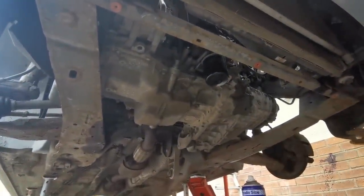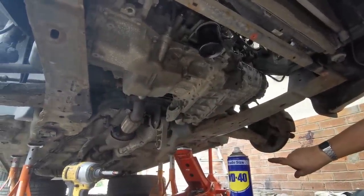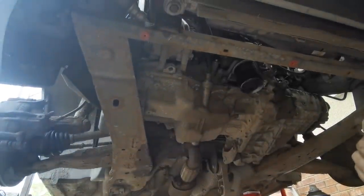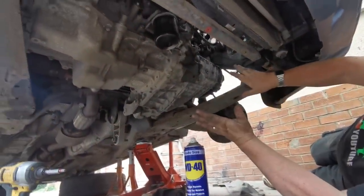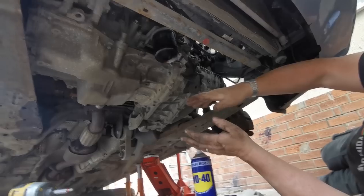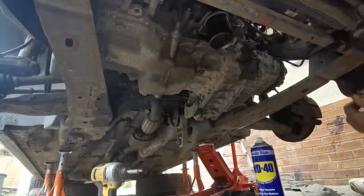We've got the two drive shafts to take out, and then we can drop the subframe mounting brackets, one at the front here and one at the back there where the jack is. We take them ones right out on this side, on the passenger side, and the ones on the driver's side, we'll loosen them about three quarters of the way. So that means we can drop this subframe quite a bit down. We've then got to support the engine. We'll undo the gearbox mounting bolt, and we'll start to lower the engine down on the trolley jack, which will be mounted here on some wood. You can either have the engine bracket at the top, as I said to you earlier on, but I think we're going to go with the trolley jack method.